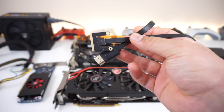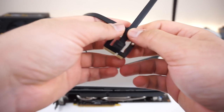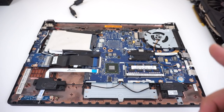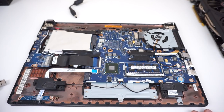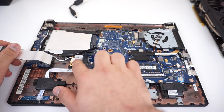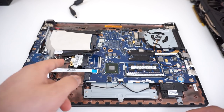We're skipping the express card since it didn't work with the laptops I have. Now we'll try the PCIe mini connector. To use it, you need to open up your laptop and access the internals to hook up this connector — and you'll have to give up your internal wireless adapter and use a USB wireless adapter instead. It really depends on your laptop and whether it supports two PCIe mini ports.